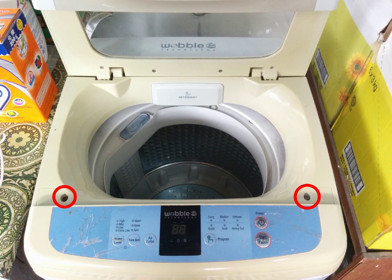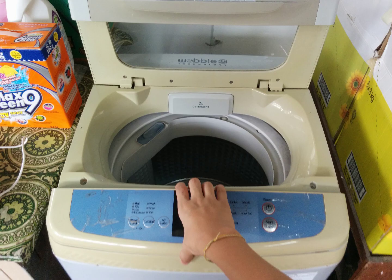To start off, remove the mains plug, then open the door and remove the two white rubber grommets. Their placement is currently showcased with red circles. My grommets have fallen out, hence why they're not present. After removing the rubber grommets, unscrew the two screws that were underneath them. If this is the first time removing the screws, they might be a bit stuck. Once both screws have been unscrewed, pull the front panel towards you and flip it upside down.